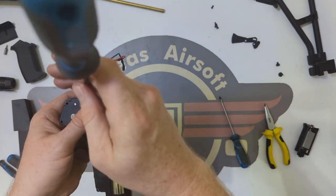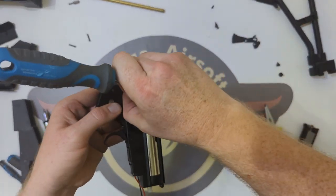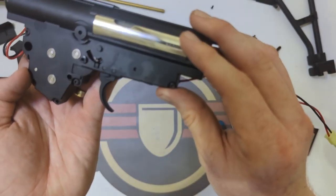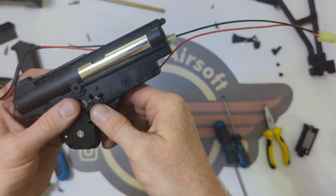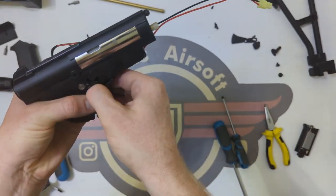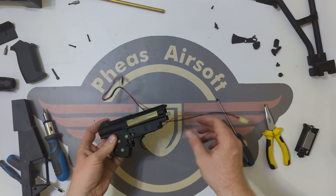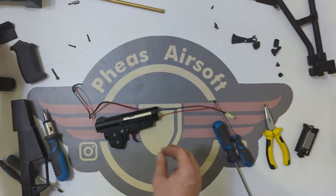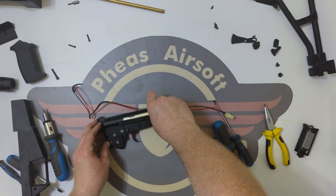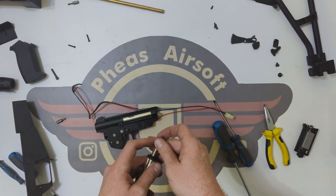Those are the metal bushings — but are they actually bearings as opposed to bushings? We will find out. I've just pulled on that little tab here. It does look like there's some dry, not-nice grease in there. I'm going to go with a T8 for the gearbox screws. And none of these are very tight either — noticing this reoccurring theme here.